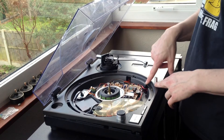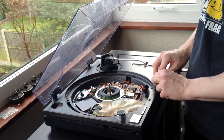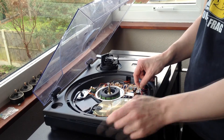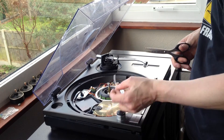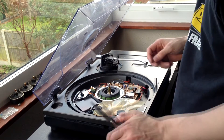Now with the target light, you've got a couple of wires that come through a hole here where the target light is. Pop your target light up. You'll see you might have a cable tie just attached at this point — you'll want to snip off that cable tie and obviously have a replacement ready for after we've done the modification.